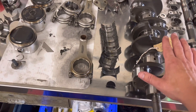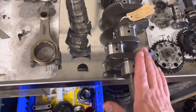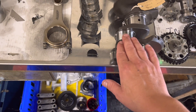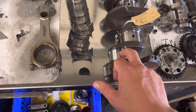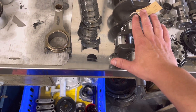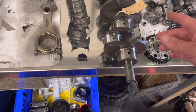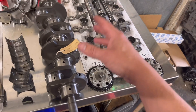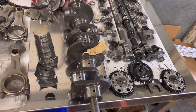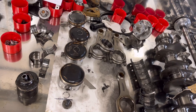The crank's all good. John's checked the crank — the mains are still at standard but polished, the crank is straight as a die. We've just ground the big ends, and the only reason for that is because it knocked this one end out. It's a steel crank, so that's a fantastic bit of kit — we're going to use that. All the head assembly there is all ready to go back in, just got to sort the head out. So yeah, we've just been set back on the rods at the moment.